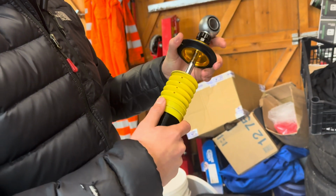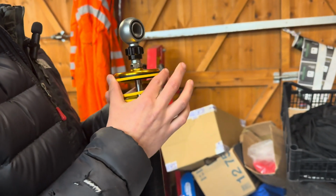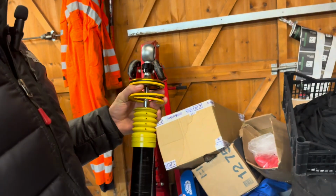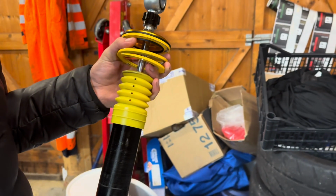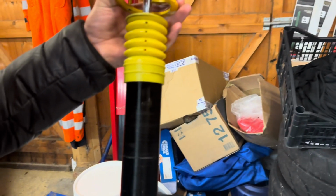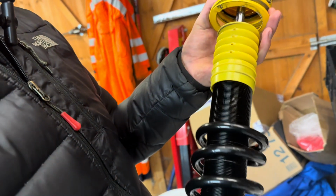I was just testing you. Just like that. Then you put your helper spring on. What does your helper spring do? Helps the spring. Then, how does it help the spring, Jay? I don't know, it's a good mate to it. So the reason you have a helper spring is to stop your suspension droop. So say if I didn't have that, my spring would be floating around. When I went over curbs and stuff, it would just wobble around. So your helper spring, all it does is help your spring stay in place, so you don't dislodge it and damage your spring. That is exactly what I was going to say.